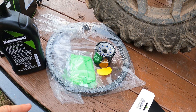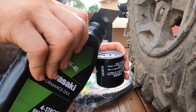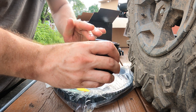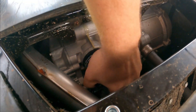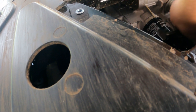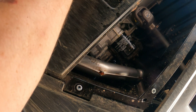I'm going to put a little bit of oil in the oil filter — I'm not going to fill it all the way because it goes on horizontal and it'll just dump out. I'm going to make sure I lube the gasket up decently. I'll thread it right on there — about an oily hand-tight — and give it probably an additional half turn. We've got a new crush washer for the drain plug. Slide that right on and reinstall the drain plug.